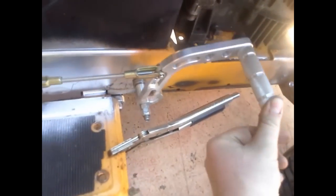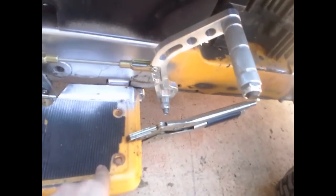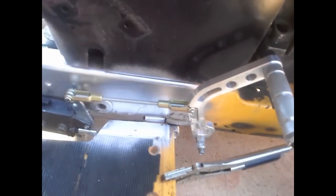The master is bolted into the side of the frame rail. Got a clevis here with a threaded rod so I can adjust the pitch on this. The lines run underneath and then go to the back of the master. There's the pedal and master working properly.